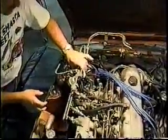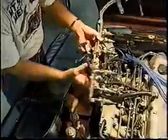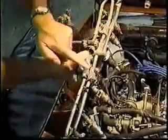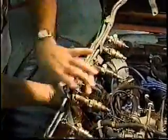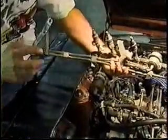I put an entire fuel loop rail system from another vehicle to show you what this looks like when it's fully removed. The injectors themselves attach to the loop rails — I call them loop rails because the fuel makes a full loop. The fuel comes in, the top goes into a splitter, goes down both ends, and feeds all six injectors. After all six injectors have been fed, it goes into a fuel pressure regulator, and the excess fuel exits through here — the bottom line.